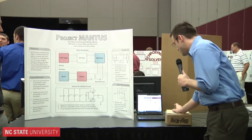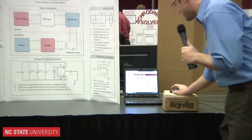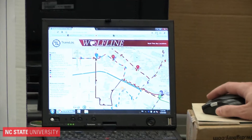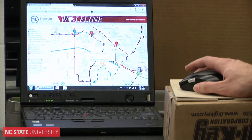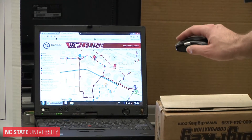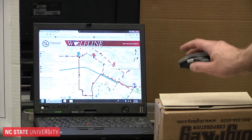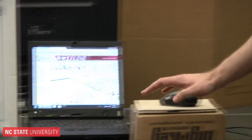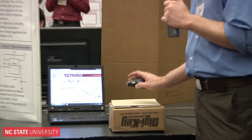You can see a quick demonstration here. Hopefully you can see on the camera that the cursor is indeed moving around. We can click here and everything works fine. You'll notice that if you lift the mouse up off the mouse pad it stops working as you get a couple inches off, because you're not getting enough magnetic flux through your secondary coil.